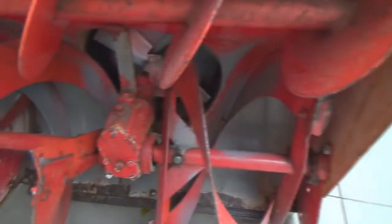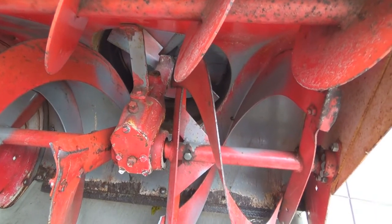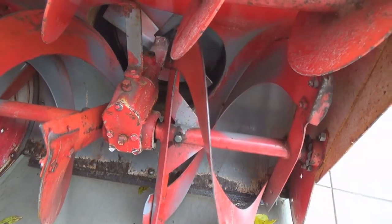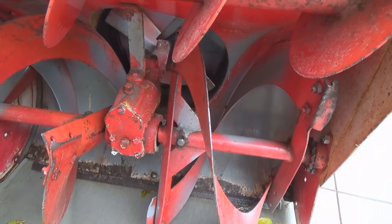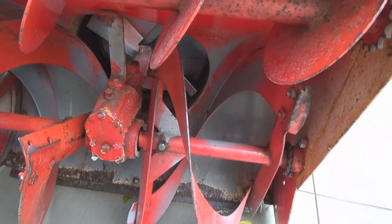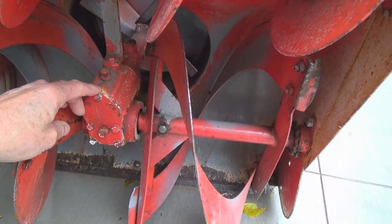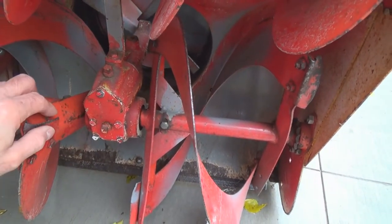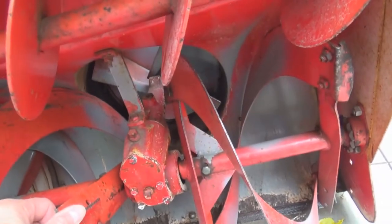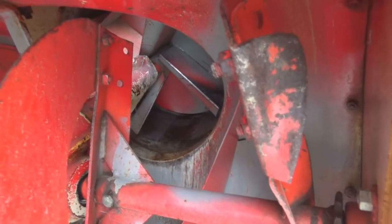I'm liking the looks of this steering box. Boy, oh boy. Of course, it's been used quite a bit over the years. And it has some play in it, but I wonder if you can adjust some of that play out of it. What I like about this, better than the one I have on the goofy cart now, is it has 2 different drain plugs. Plus, it's got an extra mounting point up here. And it has a long shaft support back in there. See that? One way back in there.